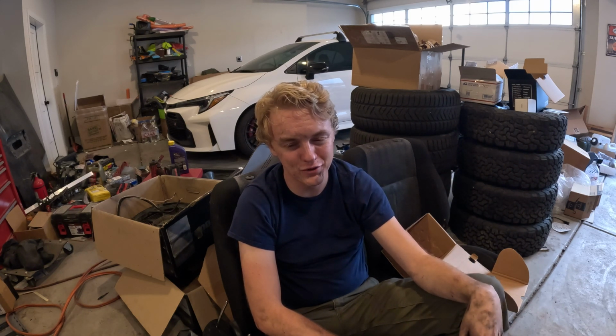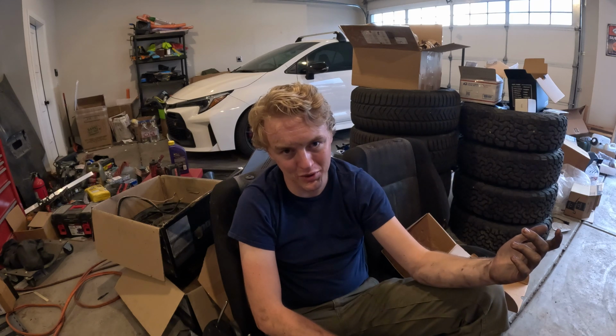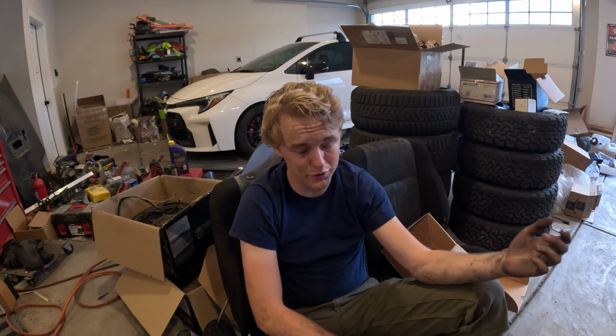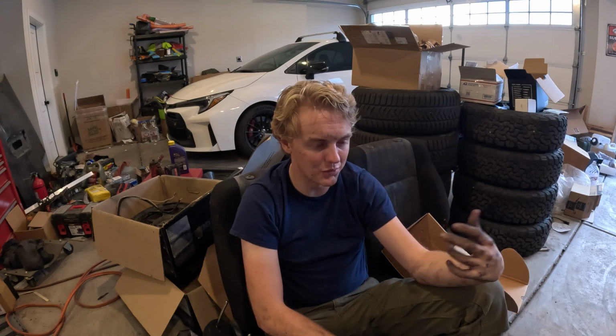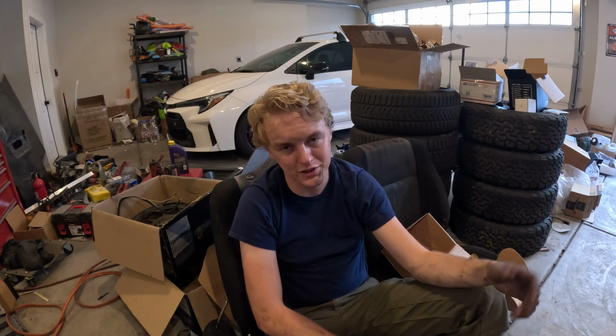I would have showed you more about fuel diagnostic, but really just turn the key, make sure you hear the fuel pump. If you don't, something's probably wrong. Then you can go a step further. If you've got a fuel pressure gauge, check your fuel pressure gauge. I'm thankful to have one of those. I highly recommend putting one in. Once you've done that, make sure you have fuel pressure. Pull your fuel line off of the fuel rail, make sure you got fuel there. You can pull your injectors, make sure they're firing. That's really all there is to that.